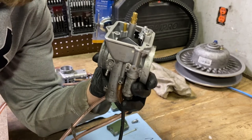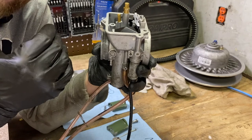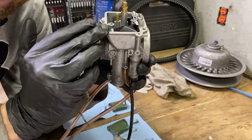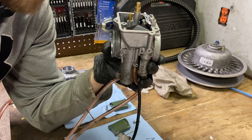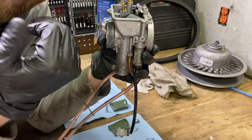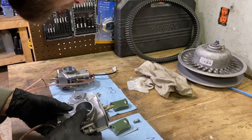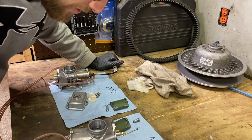I think I might just leave the floats because I'm already making a lot of changes - and obviously if you're used to tuning motors, you change one thing at a time. So I'm going to hard jet it, get rid of some of those crappy fuel lines, and see where we go from there. I don't have the race manual for this sled so information is a little more scarce. I definitely want to run the sled with just the jetting changes first before also changing floats, because that's a bit arbitrary.